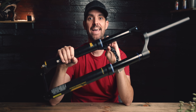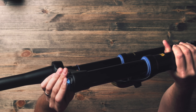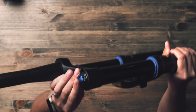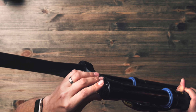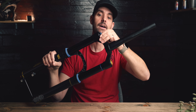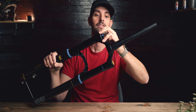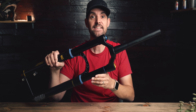It's got these nice blue SKF wiper seals that sit at the top, matching the anodized blue low-speed compression damping dial just at the top of the fork, which has 15 clicks of adjustment. Underneath is the black high-speed compression adjuster with three settings and a climb mode for anyone that still uses that.